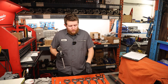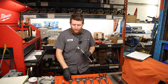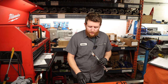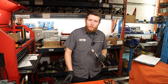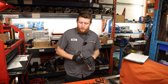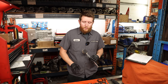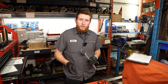Now that we've got our rod bearings all installed, we've completed the steps on the first rod: checked our big end size, torqued our main rod bolts to specification and verified it was round, checked our shells, checked the pin bore and pin clearance. We're going to repeat those steps on all the rods. We've measured our crankshaft rod journals and now we're going to set the micrometer to the dimension of each rod, measure each one, and match our rods to each journal based on clearance.